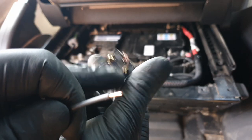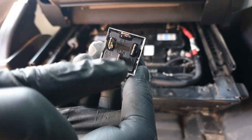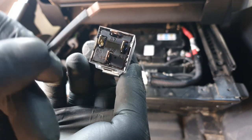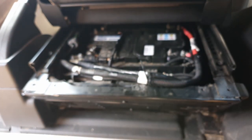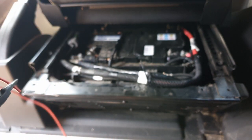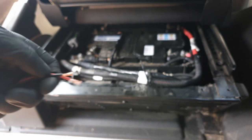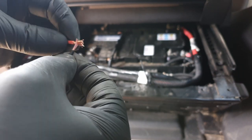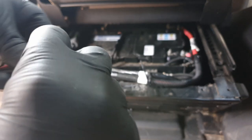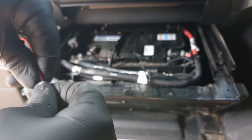Our supplies: the first wire goes straight to pin 30, and then we make a link wire going to pin 85. Those are our two lives - the live for the switch and the live for the relay coil, covering the main supply and the switch inside the relay. I'm putting a spade on one wire and then twisting two wires together to crimp onto a second spade connector to link to the next terminal.